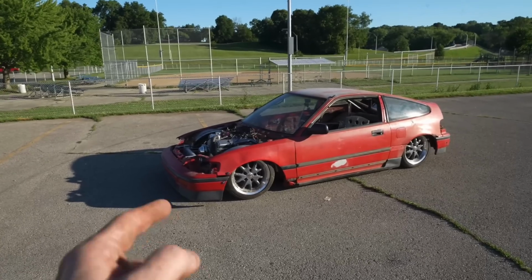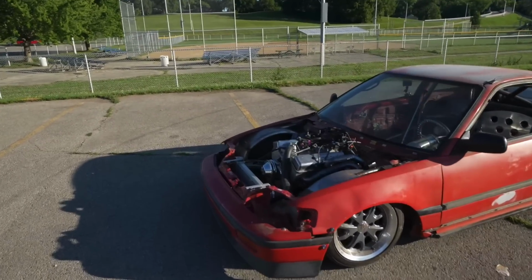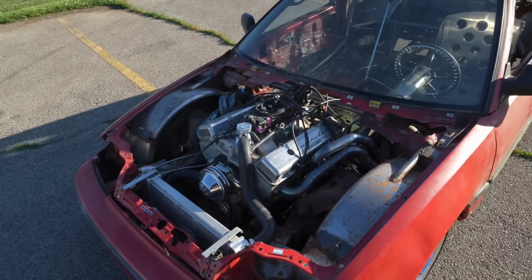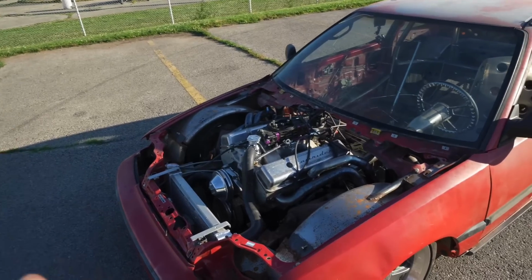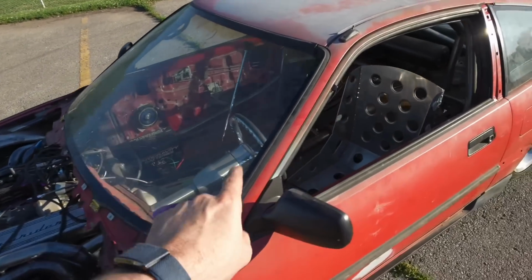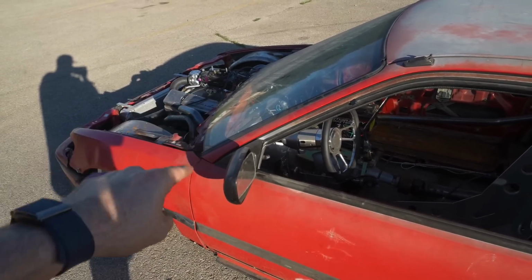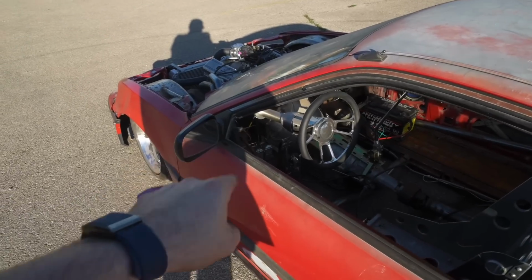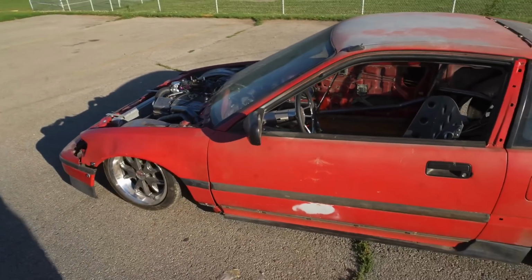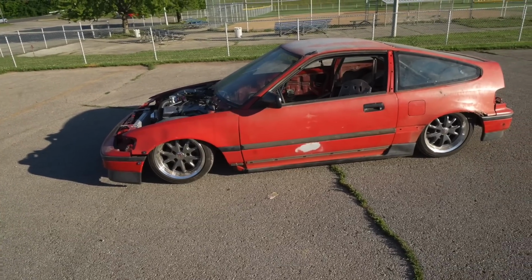So, I was trying to talk earlier when the engine was running. You might not have heard me. I had to change this to a front engine mount. So it mounts way up here in the front instead of the middle of the engine. And I had a couple guys, like drag race guys, who have to do that. They told me whenever you have a front mount, you can't have a tail mount because there's too much pressure, basically where the transmission bolts. You need to run little side mounts coming off of there. So I'm definitely gonna have to add those because I feel like it's flexing a little bit, and that's the noise I'm hearing. Because every now and then I'll have a little bit of chatter, and you can tell it's like flywheel. I thought at first maybe the starter needed shimmed, and it might still, but it's definitely not that.